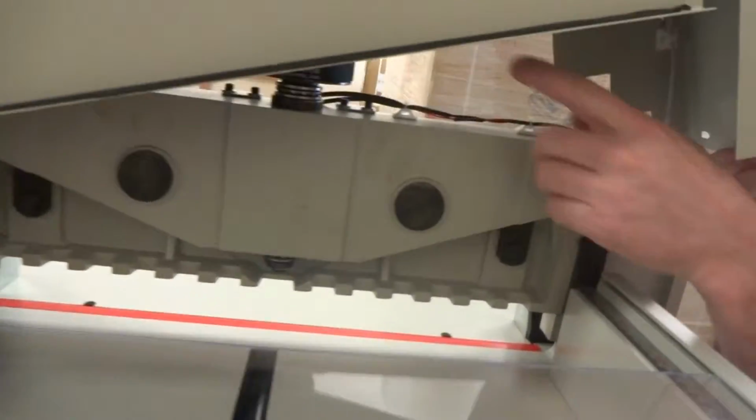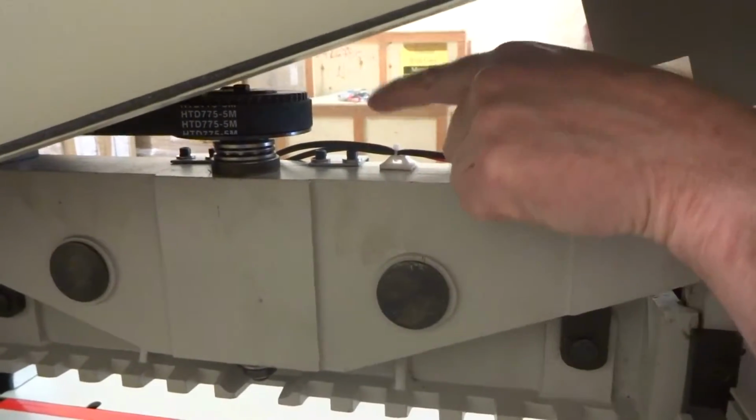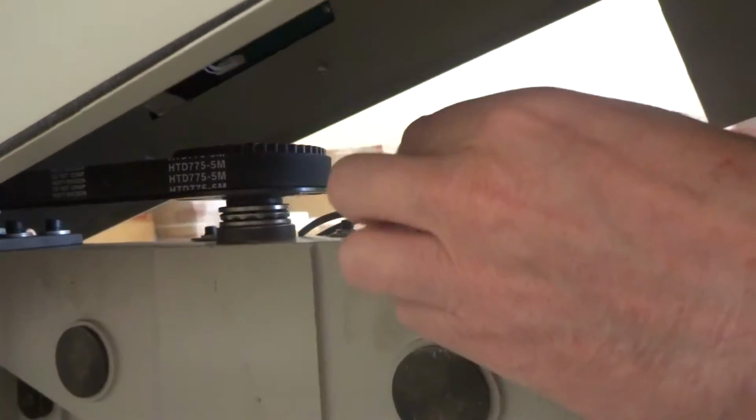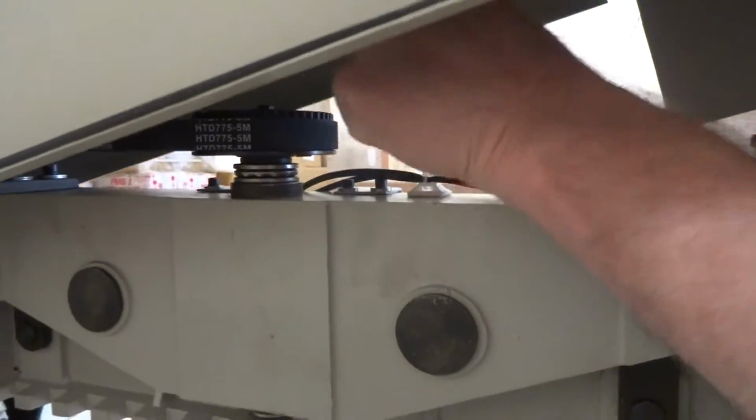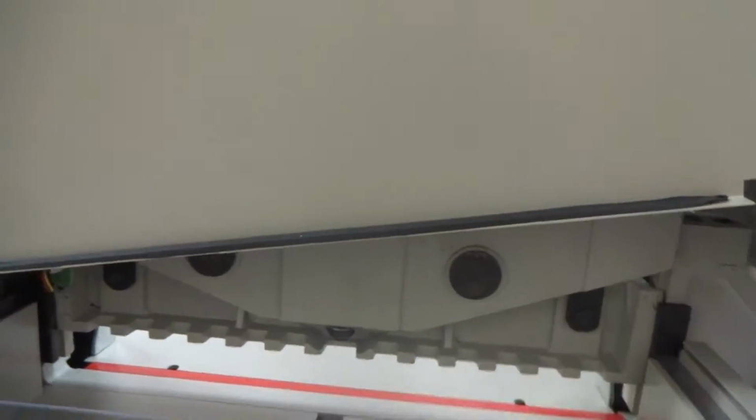you can't really see it here. If you look up in there, you see it. You would be unplugging that right there. You'd be reaching up in here and unplug it. But if you lift up too high, mid-2015 and before, they're connected. The wire's connected to these stick tabs with zip ties, and it just got a little bit of slack to get up that high. So you can only lift this up so much, a few inches, before you unplug it. And then you just unplug it, and then you can take the crown and sit it wherever you want and work on it.